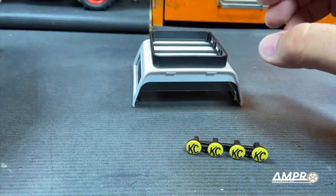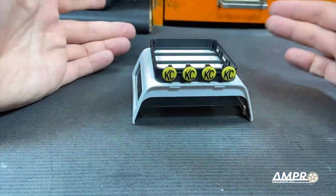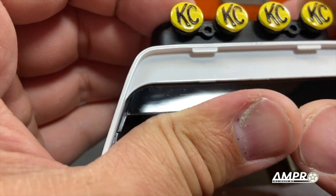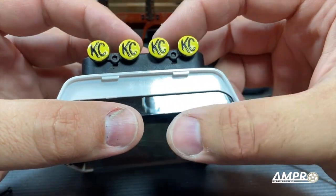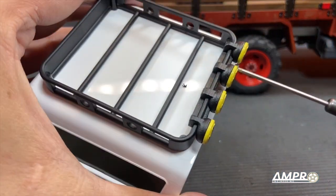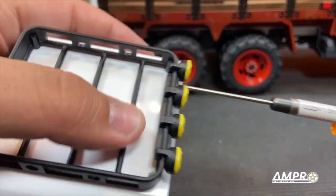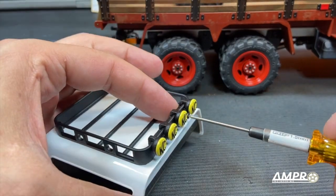These are my little cheap FDM test prints, and this guy here is pretty much in. There are a couple of holes here. I'm going to drill that hole out with probably a 2.5 millimeter bit, and then we'll just put a screw straight in. And that's basically all you need there. The hole is a little over 2 millimeters, because it's an M2 screw that holds this thing in place. Although there's really no M2 screws on this vehicle, at least readily accessible, the reason why I didn't bother going with an M2.5 like the car already uses is because those are a bit harder to find.